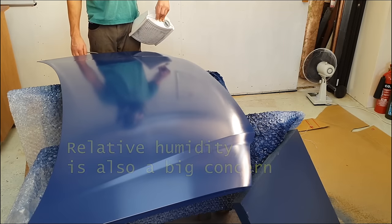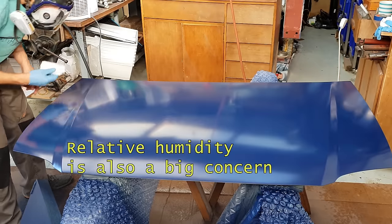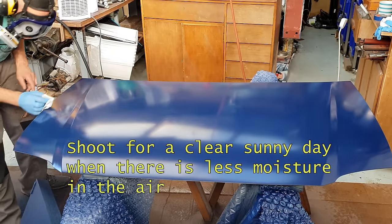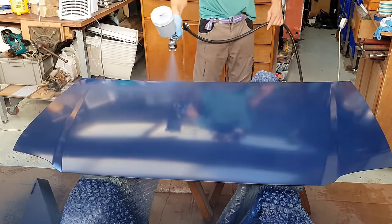The difficulty in making a spray booth, in air quotes, is that in the UK at least, it's hard to get the airflow required and control the temperature at the same time. In my case, I've got air rushing in through that bed sheet, which means it's slightly filtered but not heated in any way. With the supplementary fan heaters you've seen, I'm just about pulling this off.